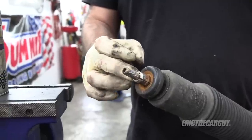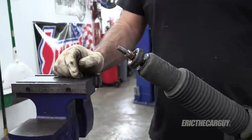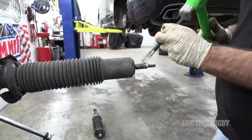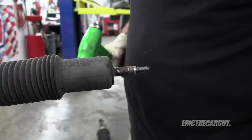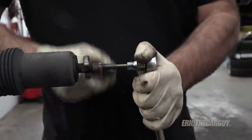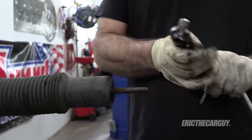This sleeve has virtually rusted into place and I need to remove it. Penetrating oil has been pretty good to me — I'll let that soak in for a minute. To avoid damage to the bushing I'll take this off right now, and since it's split I'm going to try to open it up a little more with a chisel. The Allen socket I'm using is a number five. Got it — now we need to transfer all this hardware from the old strut over to the new strut.